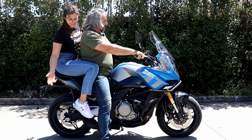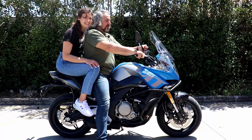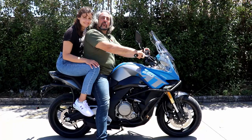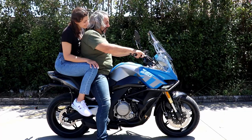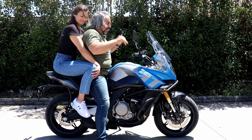We have high pressure tubes. We have see-through tanks for the brake fluid. This is not so positive, because if it's see-through, it's easily destroyed by the sun. It's better for the tanks to be aluminium. But anyway, the clutch is with a wire, typical. Also, the handlebar can be a little bit lower if you like, if you change it, because it's a little bit up, but it's nice, it's friendly. I love it, it's nice.